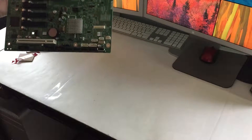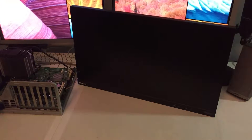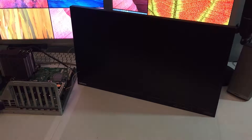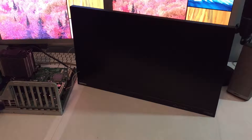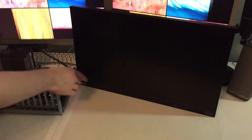So we are now going to plug it in and test it. You can see it's quite a bit later. The front panel header has two wires sticking out of it because it's more along the proprietary end of things. I looked up the pinout for that and it's kind of just like a standard header, just not labeled. A lot of things are clumped together on it, but I found the power button and ground for it. So if I bridge those it'll turn on, and that's what I'm going to do right now.